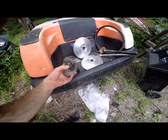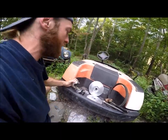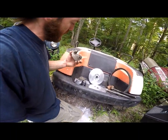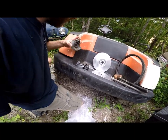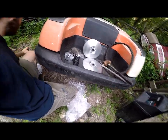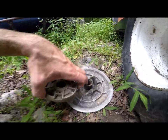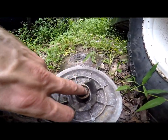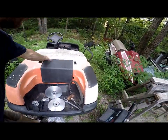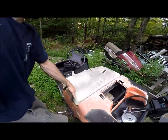The old one probably doesn't even have any material left inside of it because bits and pieces came out when I took it apart. This one's pretty worn and shot — it never would have slid correctly; it would have grabbed and held without really shifting smoothly. The broken spring alone meant it wouldn't even work, and the rest of it doesn't look like it was greased in quite some time.